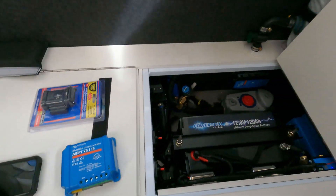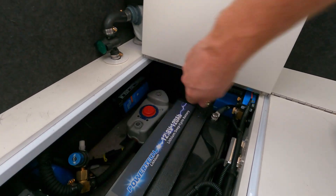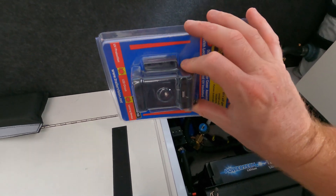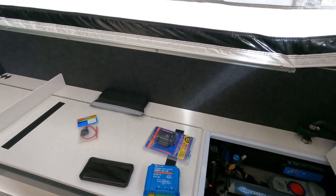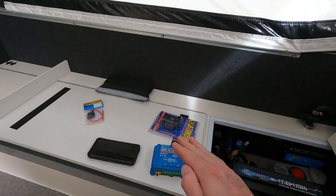First up, I'm going to tuck her away in the corner just over there, mount her up and run the cabling. I'm just going to run this guy up underneath the trailer with a weatherproof Anderson plug, and then when my rack eventually arrives I'll be plugging a permanently mounted solar panel onto the rack. So that's just ready for when that arrives.